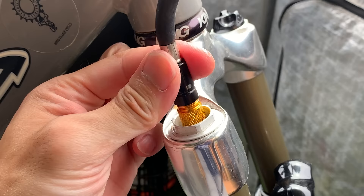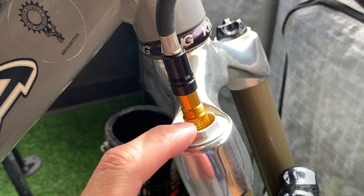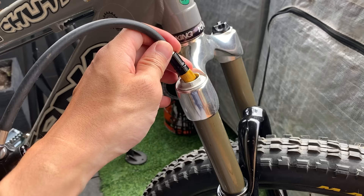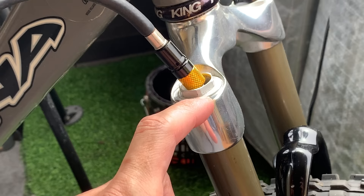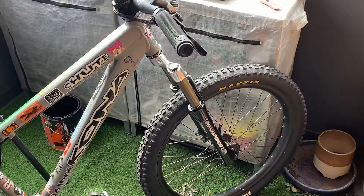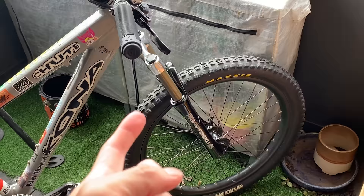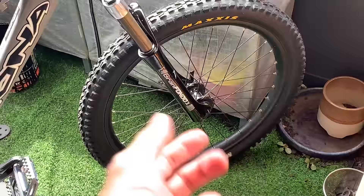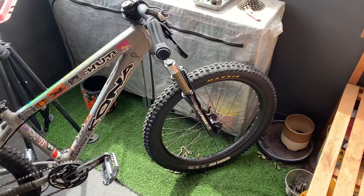Once you've pumped it up, unwind the top black bit first — you can see it's going to pop off — that way the air pressure in the pump hose is gone and you can unscrew the second part without the fork losing pressure. If you unwind both together, air pressure leaks out as you're unwinding. The black thing adds a little chamber so you can unwind it without letting out too much pressure. I like to run mine about three bar on the top, with a high to medium spring-back rate — run it fairly stiff. Every fork's going to be different.